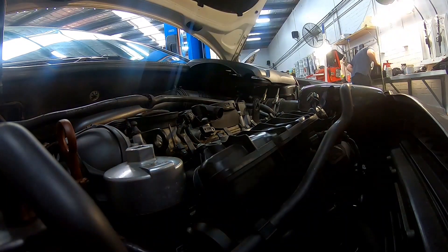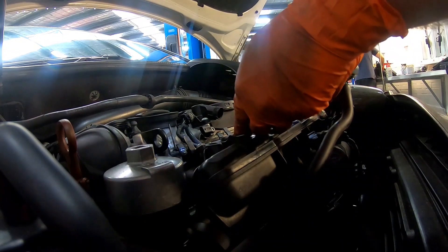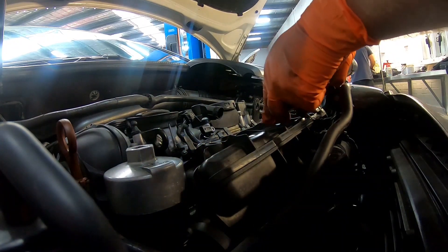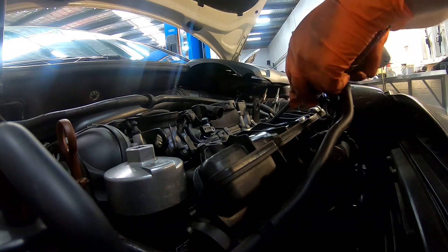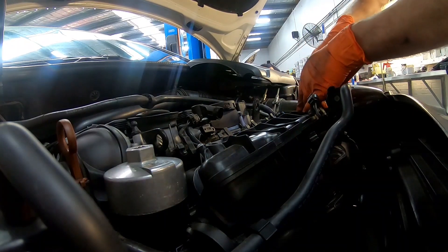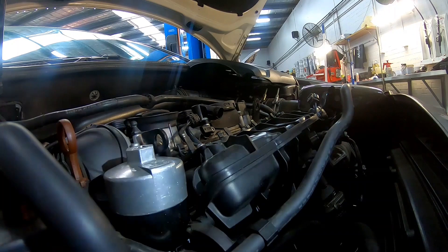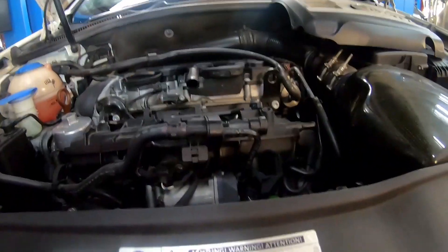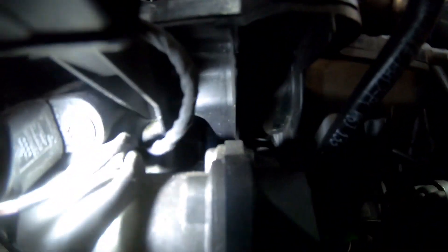I'm just going to chuck my old fuel cup on here and we'll use that later to get the filter off. I'm going to start whizzing out the bolts that hold the inlet manifold to the cylinder head. They're mainly T30 bolts that go the whole length top and bottom. Looking down with a torch you can just see the T30 heads of the bolts through these gaps - that's what we're sending our extension down to undo. There are multiple T30 bolts holding this on.